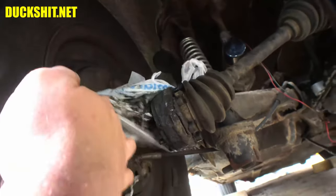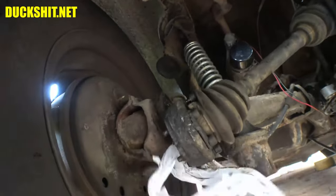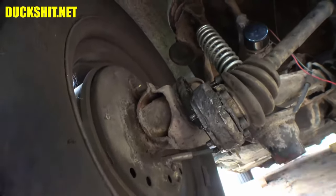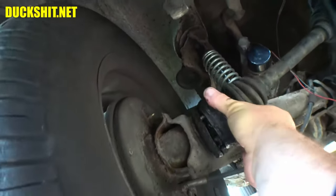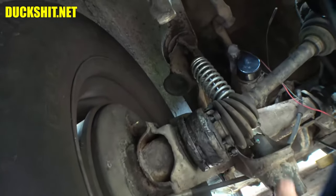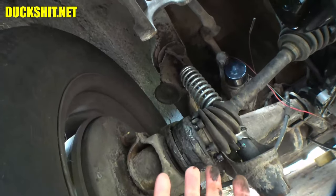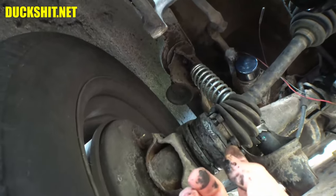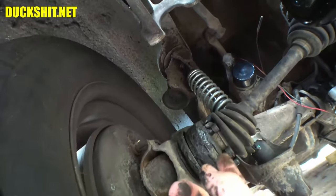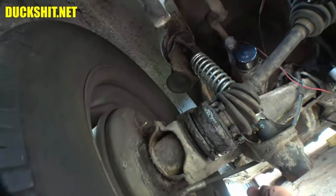The following day — we're going to handle our CV joints. Remember, we had these bagged up to keep them dry and clean while we were working on other stuff. Got to get this bag out of here. I hate CV joints — barely touch anything and I'm already filthy. These usually aren't too bad as long as you get the bolts to line up. I'm probably going to get the bolts lined up on one side and then the other side won't line up, so I'll have to jack it up and spin the wheel. We'll get these bolts started with an impact, then come back with a torque wrench and get them all torqued down.